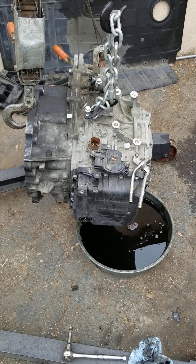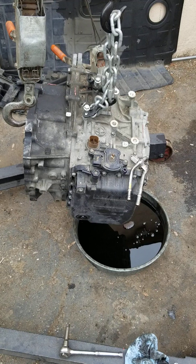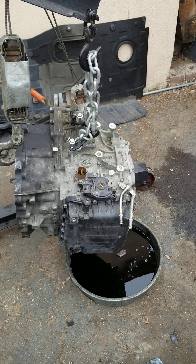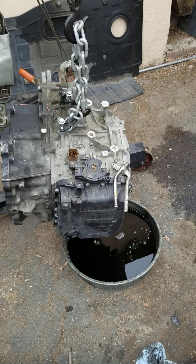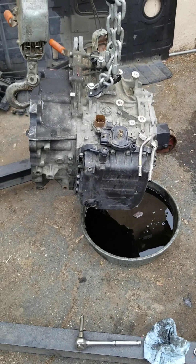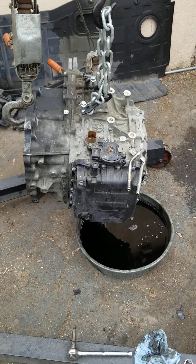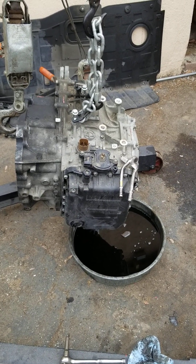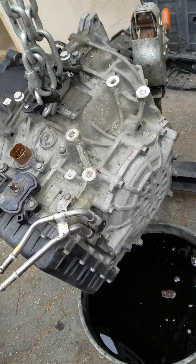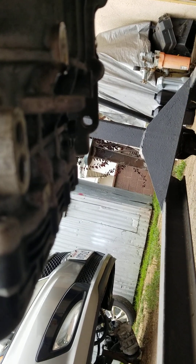We'll probably take and rebuild this. When you do a drain and fill on these type of transmissions, you can't really tell where they're telling you to do stuff. The first thing you want to do is drain it. This would be the front of the car, and this pan right here — it has a valve body in it — would be facing the front of the car. It's almost behind the left front headlight. Your drain plug is over here on the side, and you'll notice it's draining out right now.